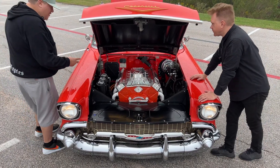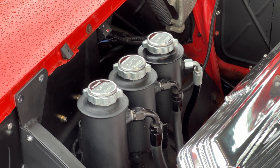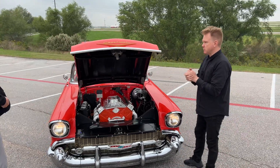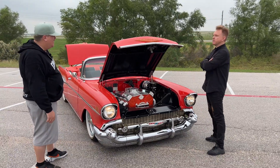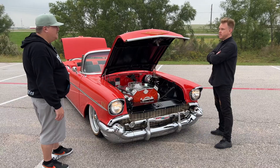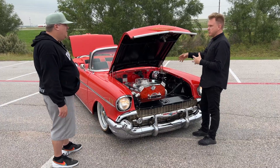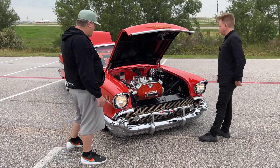There are two cooling loops in the vehicle — a motor cooling loop and a battery cooling loop — plus power steering. Tell us more about the rest of the system. We're using a Delong charger, 6 kilowatt. We have plans for fast charging — there's a company we're working with to get fast charging in all of our builds. Because it's water-cooled, it's pretty much ready for CCS — exactly.